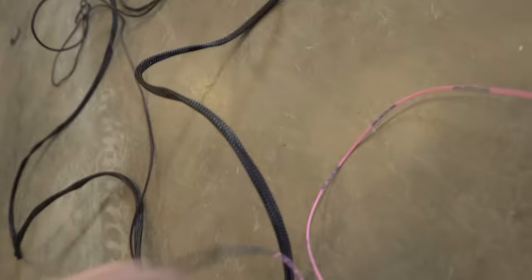The remote turn-on wire is ran. The very last thing I'll do is connect the two main wires — red and black — to the battery. The red wire is definitely getting a fuse between it and the battery. In the trunk right now, all the wiring is tucked under the back seat. The only wiring you need back here is the wire going to the manifold or ECU. The air compressor is sitting in there for now.